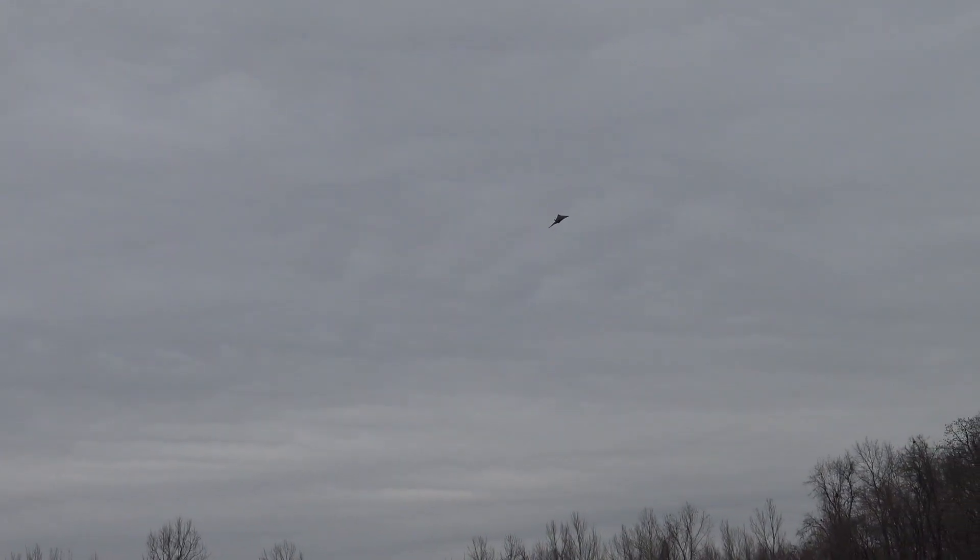It should get a little bit longer flight time with the 2600 milliamp battery. They're only rated to 60C, but you're only pulling 42 amps — that's only about 20C, actually less than 20C. That's about half throttle. I think the cheater holes definitely help the performance, and if we get a higher rated motor that performs better, it'll definitely wake it up.